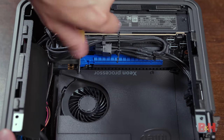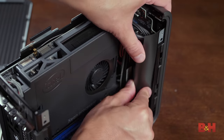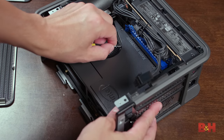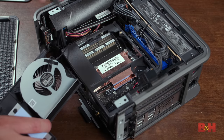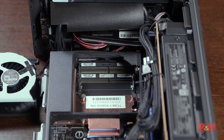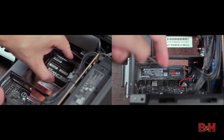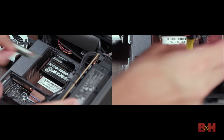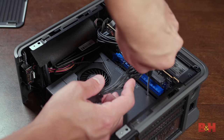again, providing a much smaller physical size than traditional SATA-style drives. I'm going to open up the module by taking out two screws on the bottom, pushing the plastic flap to the side, and prying the inner frame of the module outward. Be very gentle here, as this part is connected by a thin wire to the board, and it should be placed carefully to the side. Now, you'll see the exposed RAM slots, and adjacent to that, the M.2 slots. I'm going to carefully install both the RAM and the M.2 SSD, making sure they're securely in place, and then close up the compute module.